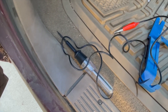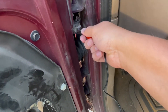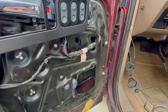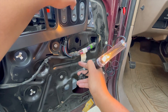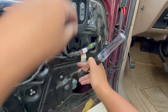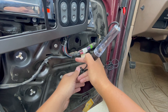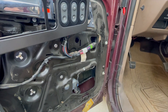We're going to use a circuit tester, also known as a power probe, to test our switch. You can find these cheap on Amazon or any auto parts store. Clip it to a piece of metal — we're going to use the inside of the door jamb. It's very important that you make sure your ignition is on. Plug the probe into the wiring and hit the switches to test. There are two terminals to test — hit the up and down switch on the window, and if it lights up there's power. As you can see, we're having power on both the up side and the down side of the wiring. That means our switch is good and the motor is getting power, which ultimately means our motor isn't turning when it's getting power. Bad motor.